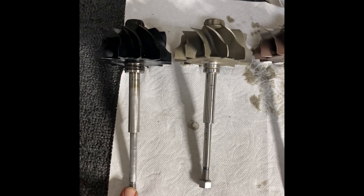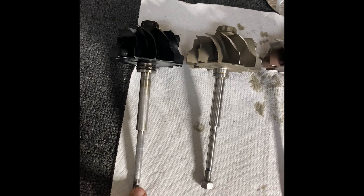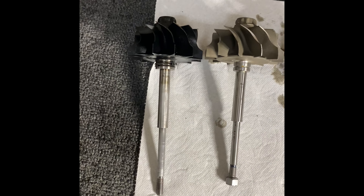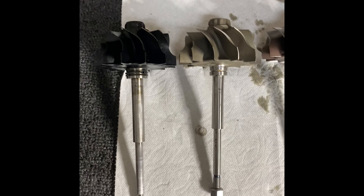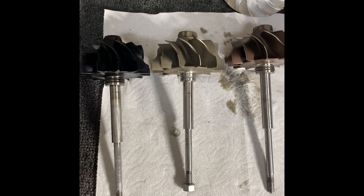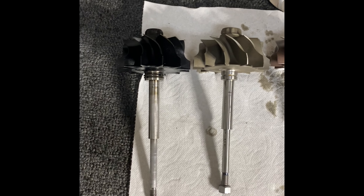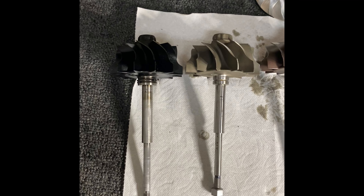You can also get off of a DD-15 a 67-70-11cm. Highly do not suggest it — I've blown up plenty of the 11cms. Just highly, highly suggest not to. The only ones that seem to survive are sub-3 liter engine applications. We put one on an N54 and they did really well.